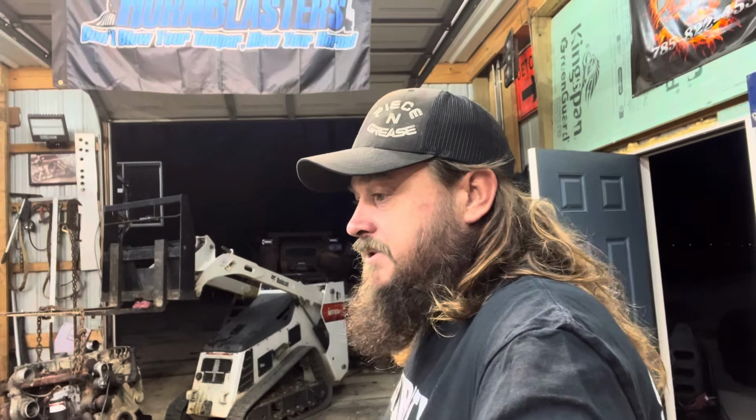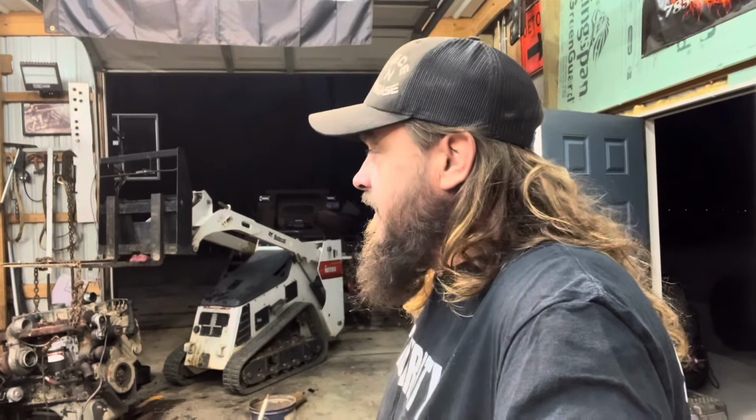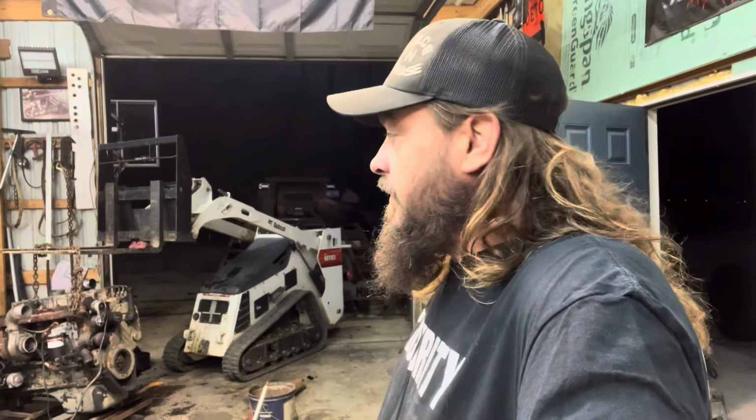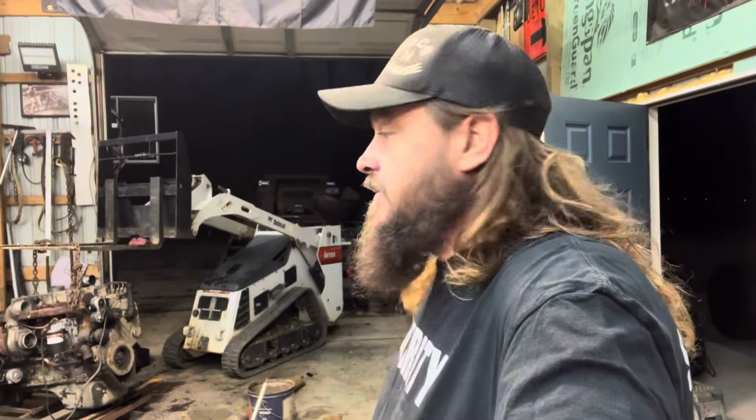If I could get my hands on that, the truck is junk, the cab is junk. I would be tempted to take that Cummins and 5-speed and put it directly in the blue truck with a divorce transfer case, Ford 205. I already got it. And I want to put a Ford Super Duty or a Ford Snowfighter 78, 79 Dana 60 in the front of that truck. And we're going to use that Dana 60 in my blue truck for our van. We're rocking and rolling. Lots of projects, lots going on.